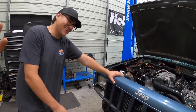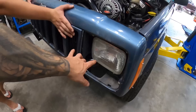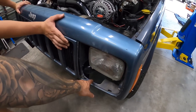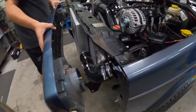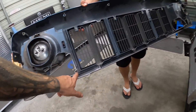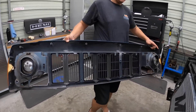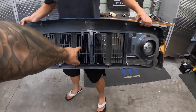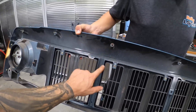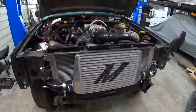We don't have AC on here, so if you have AC it'd be a completely different story. But we've got our grille in place. We ended up cutting out the back of the grill so it could fit — we had to take out the corners on both sides so our intercooler piping could come through. We also had to shorten a couple of tabs that were sticking out and touching our intercooler, but she's all on there.